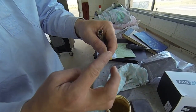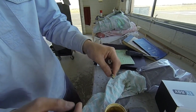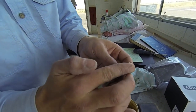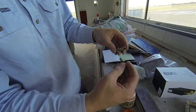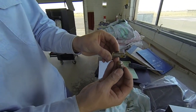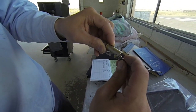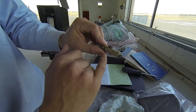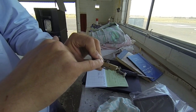You don't need an excessive amount of grease, just enough on the ball - something like that. I just normally wipe a bit in the coupling as well because when you put the ball in, it spreads it around. When we go to connect it, depress the wedge fully and then it'll slide on like that, and the wedge will come back up. It's perfectly normal for it not to come all the way up, but the thing we need to see is that hole through there.